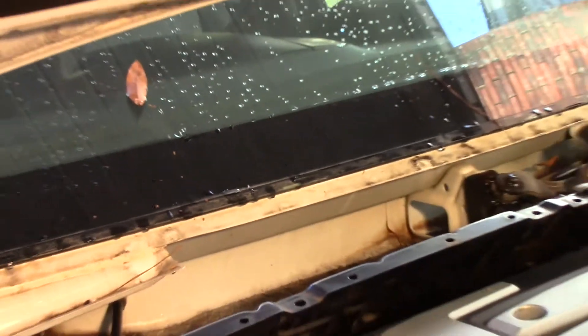It was that drain right there. I'm going to pull the smoke machine down, pull the fitting out, and call that a confirmed repair. Obviously if the smoke is getting into the cab from behind there, that's dumping into the dash — that's why we were getting water in the compartment. I'm calling it a confirmed fix. I don't know why that fitting was pushed back. Somebody had to have been in there at some point and pushed it back, or it was never right from the factory. This was an '03 with 91,000 miles when we got it and the connectors were extremely corroded — falling apart in my hand. That's actually why the car came in: it had a check engine light on for the constant positive memory going to the ECM.